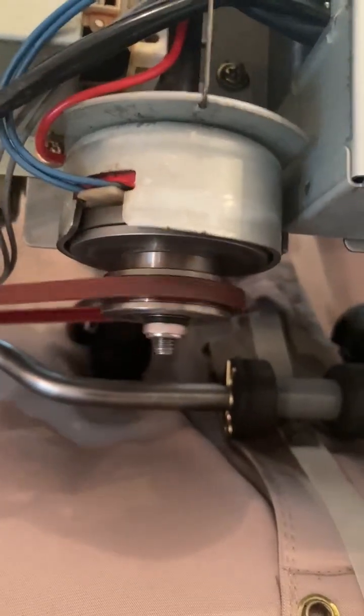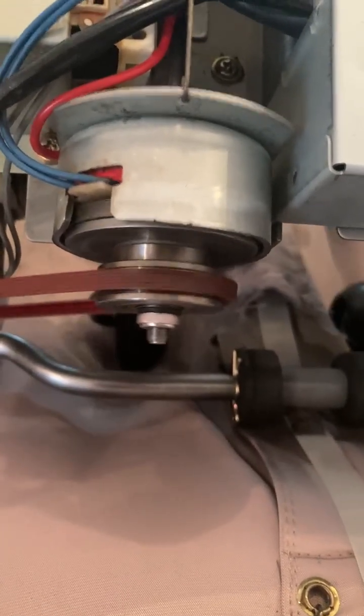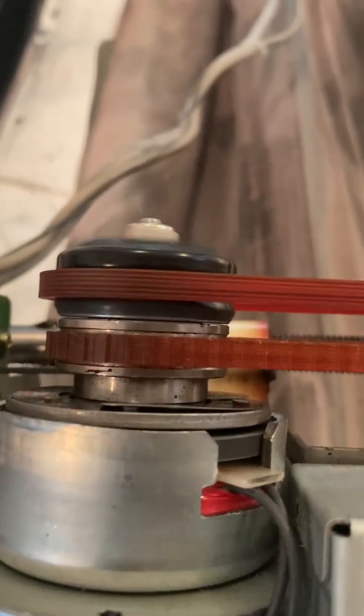And then very carefully, you have to pull off that flywheel there, and there's nowhere to grip it, so you just have to rotate with one channel lock on the hub and some tension on it, and then hold the other side here. This one over here is the same thing. The front pulley is a press fit. The secondary one is a clutch activated one.